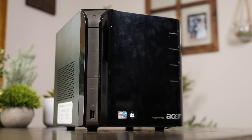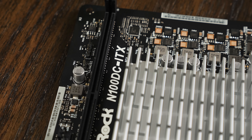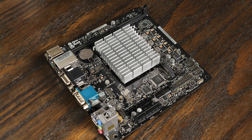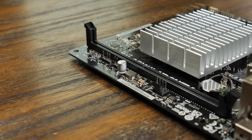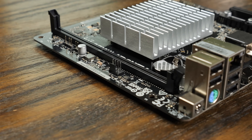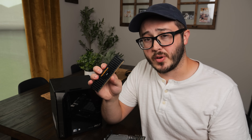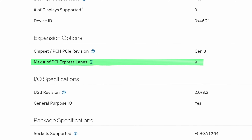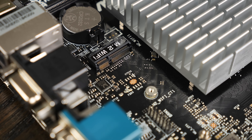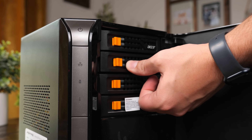So that's exactly what I plan to do today. We're obviously going to need some hardware, and so that's where this comes in. This is the ASRock N100 DC ITX, an ITX motherboard that features the N100 CPU. While it is a cool motherboard, it definitely comes with some downsides. One problem is that the N100 CPU only supports single channel memory, so there's only one DIMM socket. For that, I picked up a Corsair Vengeance 32GB DDR4 module rated up to 3200 megatransfers per second.